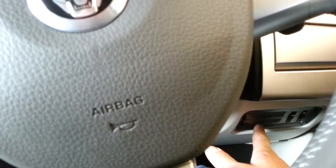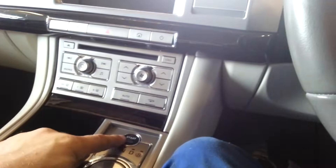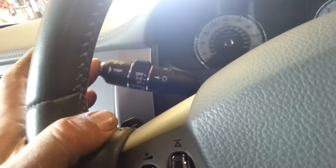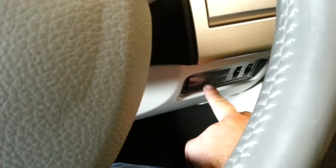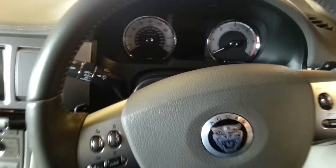You're not going to start the engine, so keep your feet on the floor, don't press the brake. The idea of this, which is all about timing, is: press and release the fog light button, then press the ignition button on so the ignition lights come on, and as soon as the lights come on, press the trip button and keep that pressed in, then straight away the rear fog light button. Keep those pressed until it says it's been resetting, and when it's reset on the dash, you're all done. It's all about timing, so I'm going to try and show you it now.